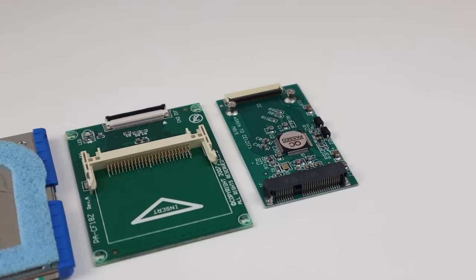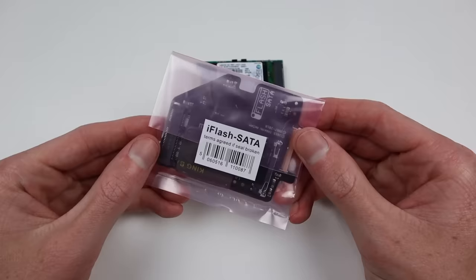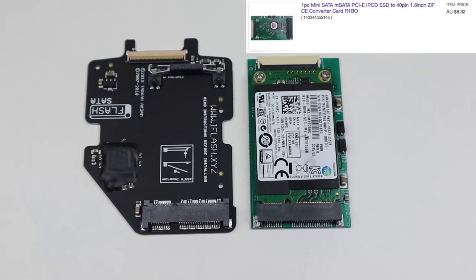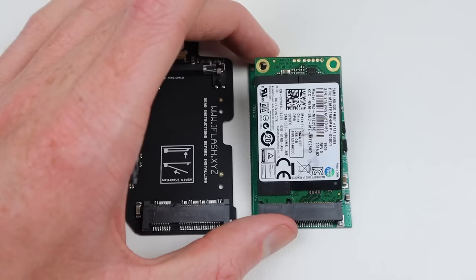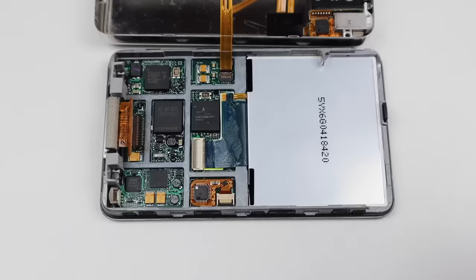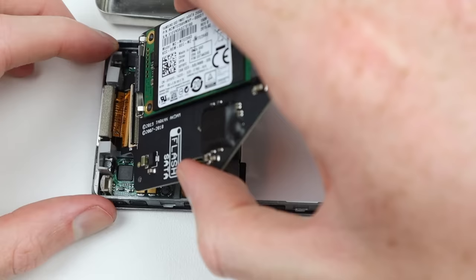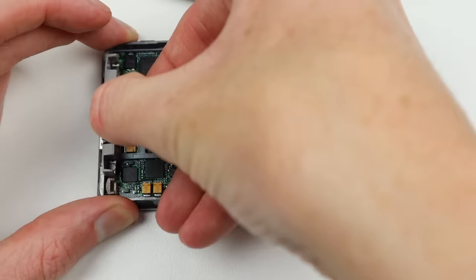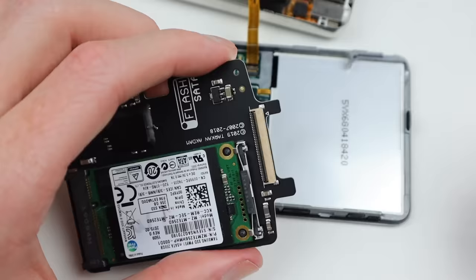There are a couple of options when replacing a hard drive: you can replace it with another hard drive, a compact flash card, an SD card, or go all the way out and throw in an SSD. These are mSATA SSD drives commonly found in smaller laptops. I started with a cheap adapter for just over six dollars that flat out didn't work and wasn't detecting the SSD in the iPod, so I went with one from a company called iFlash. This set me back fifty US dollars, which with postage and exchange rates was about 75 Australian dollars.